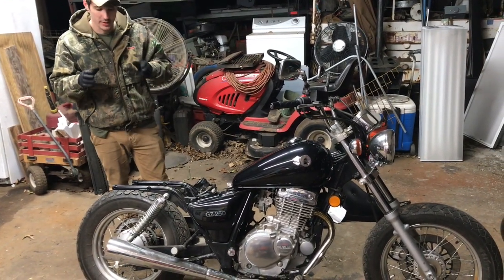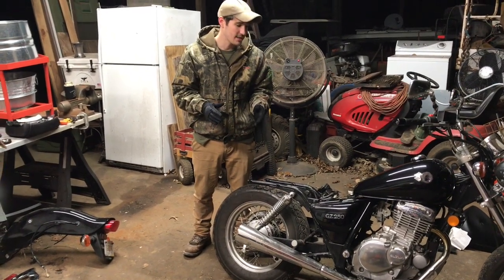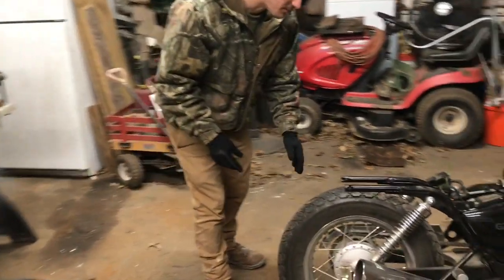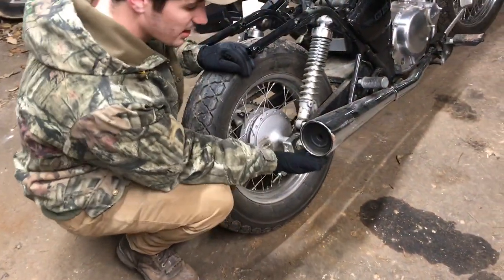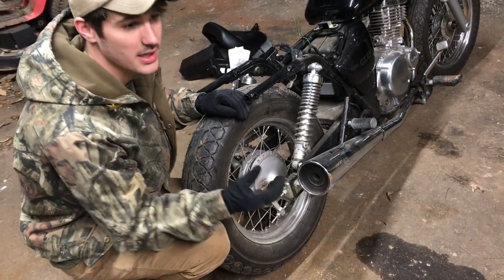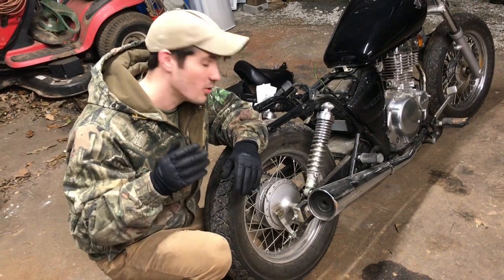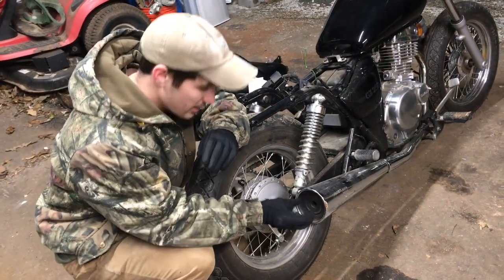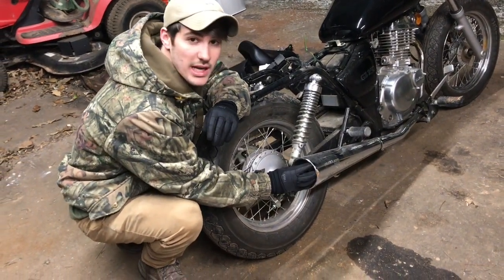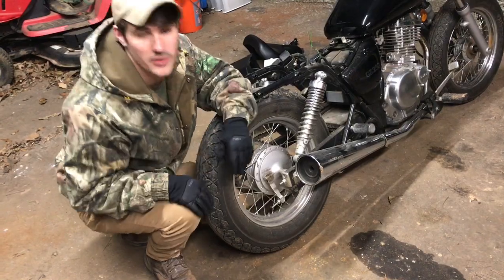For now I'm going to work on the muffler and we're going to try to straight pipe this thing. For the exhaust, I wanted to take the baffle out to make it a straight pipe. Most aftermarket exhausts or some stock ones will have two screws underneath so you can remove the baffle. The baffle blocks the exhaust coming out, redirects it through a bunch of holes, which dampens the sound and creates more back pressure — we don't want that. Since I have this chrome lip going around, I'm going to use a hole saw and drill straight in to take out the baffle.